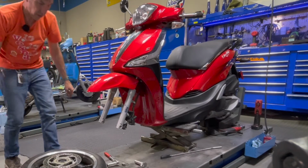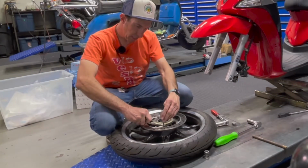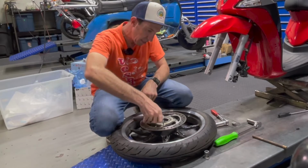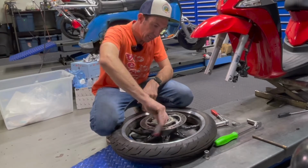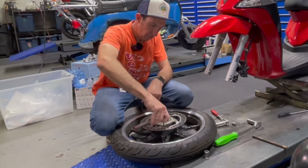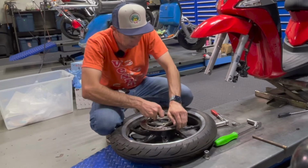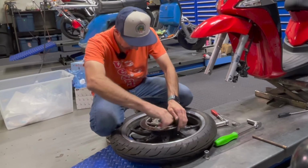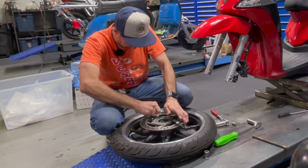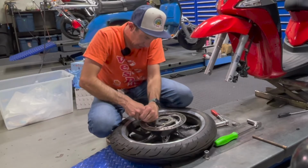Sometimes these fasteners are very, very tight, so you may need to get heat on them. So T25 Torx driver, and if you're going to struggle with them, I would just get some heat on them, usually with a small torch. And use a hand tool on all of them just to break them free. You want to put some pressure on them. That's so you're less likely to strip these fasteners out. So there we go. We're looking good. I'm very surprised there's not as much Loctite.